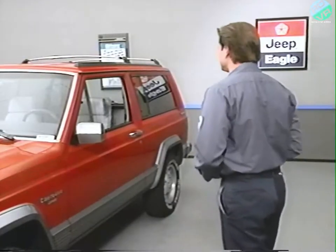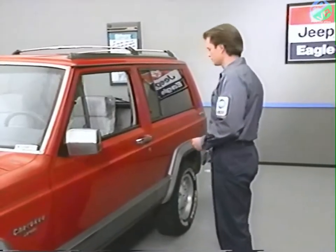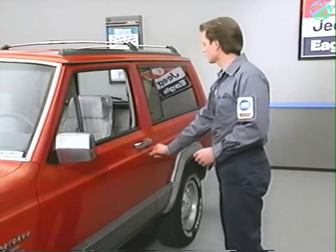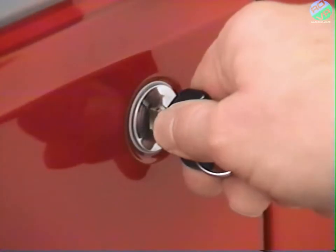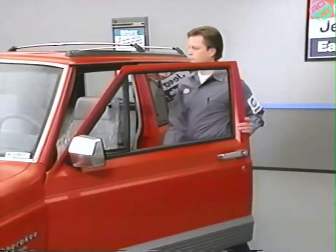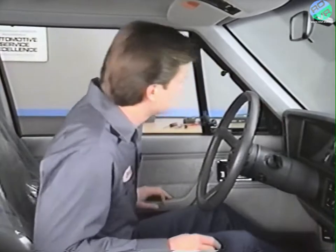Rotate the key in each of the vehicle's exterior lock cylinders to the unlock position. This will also test the lock cylinder disarm switch mounted to the back of each lock cylinder. Again, the horn should sound as the switch closes and also as it opens. Failure to do so indicates a failure of the lock cylinder disarm switch.